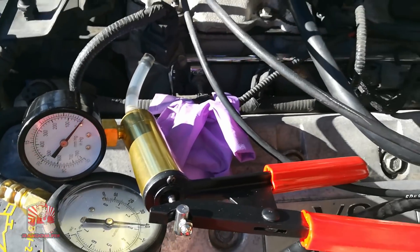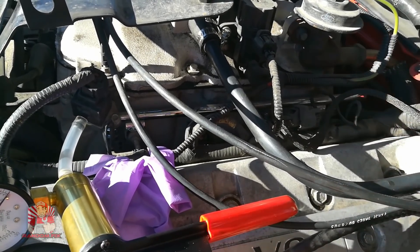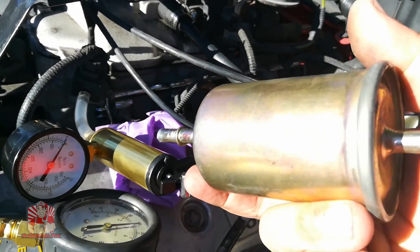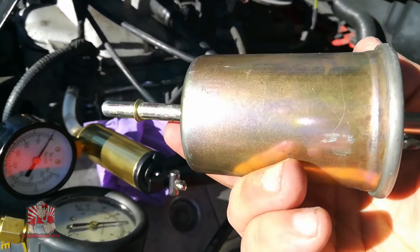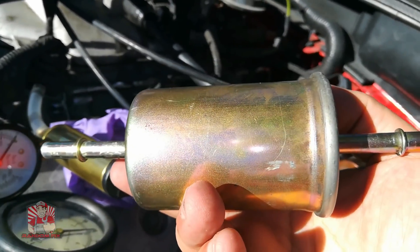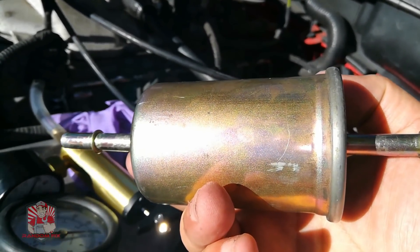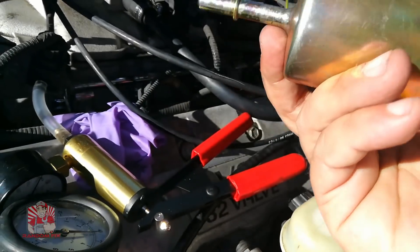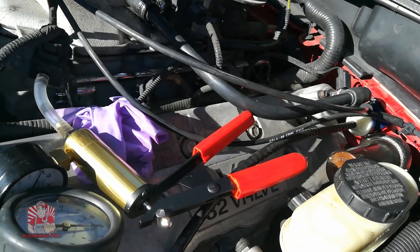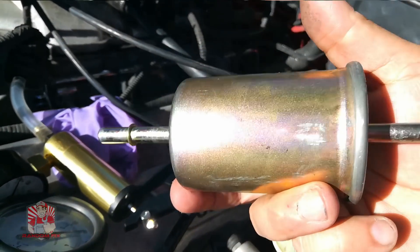Before the fuel gets to the fuel pressure regulator, it goes through a couple other obstacles that may lessen the pressure. One of the obstacles that it goes through is this fuel filter — this is the fuel filter from this vehicle. That's actually how I fixed it: I replaced the fuel filter on this car and spent about 15 bucks total doing it myself. Now I have a vehicle that runs, it's going to pass smog, and it's going to be a lot of fun for a V8 stick shift sports car. A lot of mechanics overlook this — do not forget about the fuel filter.